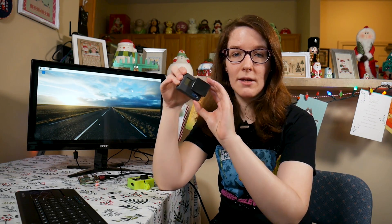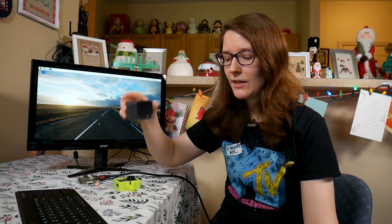What happens with the newer cameras is you first of all can't just turn on Wi-Fi. In order for it to actually broadcast out the Wi-Fi signal initially, you have to connect it to the GoPro app. Once you connect it to the GoPro app, then the network is open because your phone has to be able to find it, and then other devices can connect to its network. However, once you connect, it's not as simple anymore to get a feed. In fact, I have not been able to get a feed out of this camera, and based on what I could find online, others haven't really been able to either.